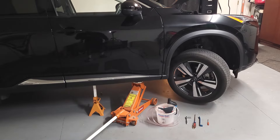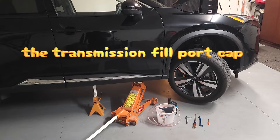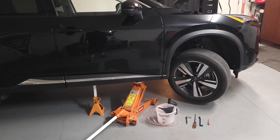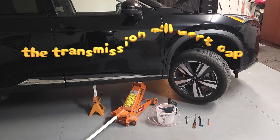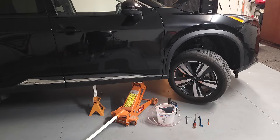The technical manual for this vehicle specifies that the fluid be changed every 25,000 miles. After placing the vehicle on a flat surface, I jacked the vehicle up high enough to get underneath the front and remove the five or six clips and bolts along the front of the cloth engine cover. From there, I was able to fold the cover downward and back to provide access to the transmission fluid pan. After that, I went to the top of the engine and removed the fill port cap so I could use it to refill the transmission with fluid. I'll show you how it looks underneath the vehicle and then we'll proceed with the drain and fill.